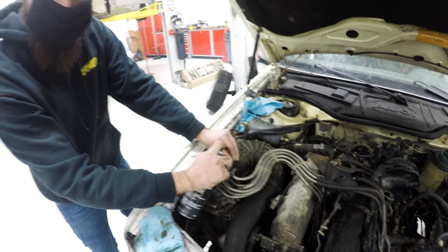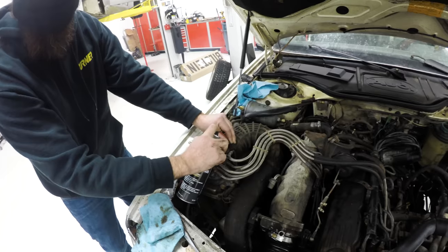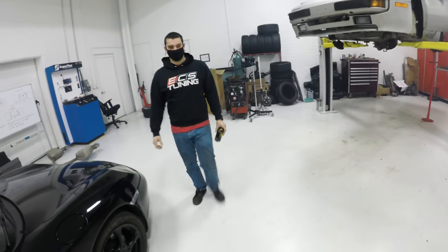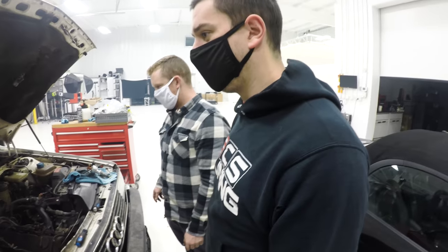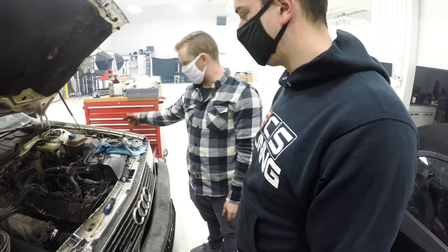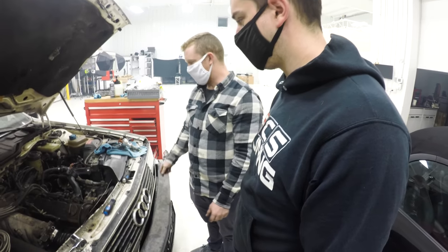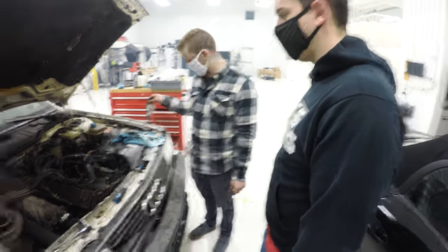I'm just winging it. Go by sound. It runs. Well, it's a fog machine too, apparently. Oh yeah, it's a factory option. So what was it? The computer? The distributor? Yes. That one's a single window on the hall sensor, and the actual sensor part is like 90 degrees away from where this one is. So this is just wrong. The wrong distributor. Nice.